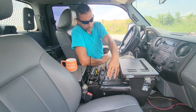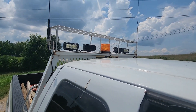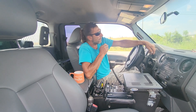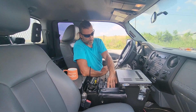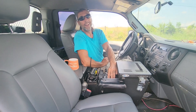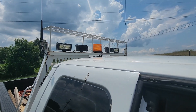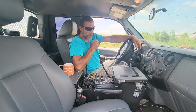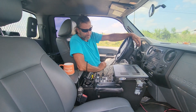We're not pointing right at the 88 with his hood, but pretty close. Ronald came back, and we explained we're making a video showing how LED spotlights play havoc on transmit and receive, asking him to just talk while we turn on the lights. He acknowledged he had actually experienced that same situation. Then we demonstrated: lights on — he's gone. Lights off — he's back. Lights on — he's gone again. Multiple times, perfectly demonstrating the effect. Ronald was thanked for his help, and the radio was confirmed working great otherwise.